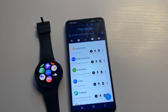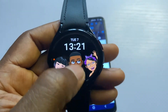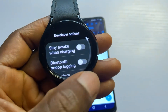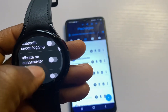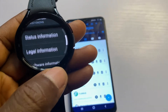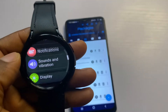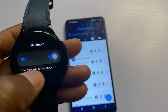Now that we have successfully installed Samsung Health Monitor on the watch, we need to turn off ADB debugging — otherwise it will impact your battery life. Go to the settings app, go to Developer Options, turn off Wireless Debugging, go back and turn off ADB Debugging. Then go to About Watch, go to Software Information, and tap multiple times to turn off developer mode. Scroll back to Connection and turn Bluetooth back on — this is the primary way the watch connects to your phone.